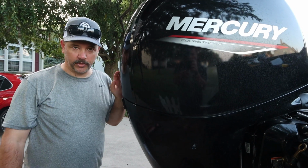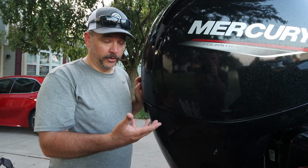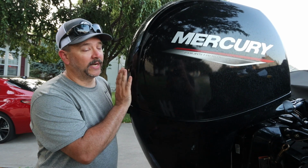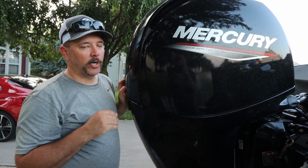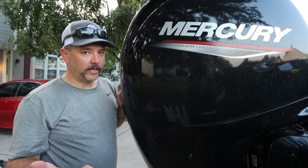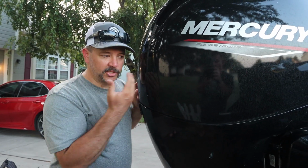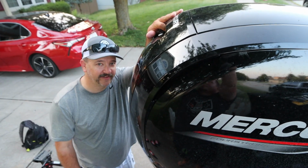I hope that I brought you along some good information. I hope this teaches you how to change the oil on your new motor. This is my first oil change, so in keeping with that, the first oil change on the 150 horse Mercury 4-stroke needs to be done anywhere between the 10 and 20 hour period of your break-in. Then thereafter, it needs to be done every 100 hours or yearly. So this is something that you're going to do every year with the engine oil and your gear oil. So that is how we change the oil on the Mercury 150 horse 4-stroke.